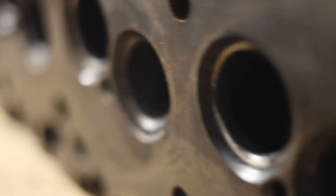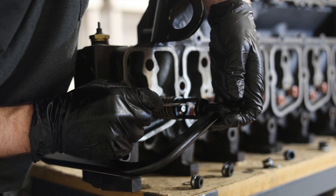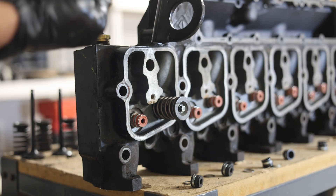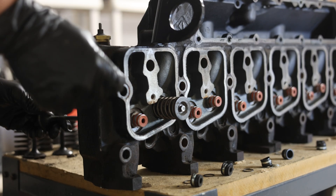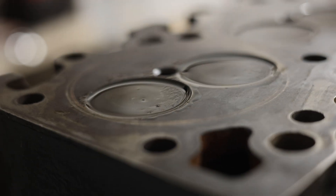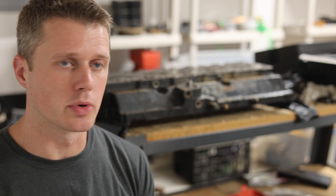Here's the first look at the valve seats. I can see a little bit of pitting and galling, but nothing to worry about. I'm not going to have this sent to the machine shop for a three-angle valve job and all the bells and whistles. We're just going to perform a leak-down test and see that everything holds some oil. We're going to put some oil on top of the valves once they're all put back in. Installing the valve train is probably the most tedious part of the whole process — making sure to use assembly lube and just trying to get the keepers in with the valve spring tool was not easy. So we've got all of our valves put back into the head with new valve stem seals, and we're going to just run this head.